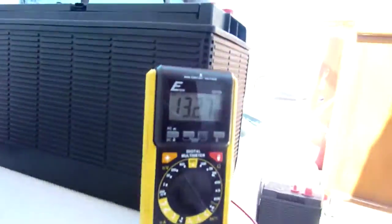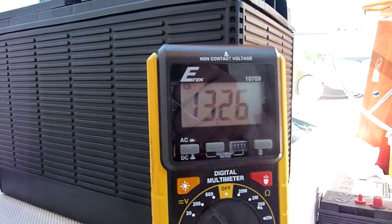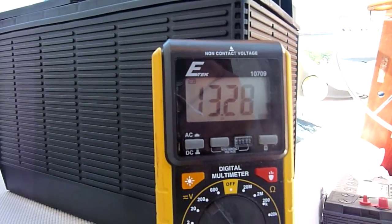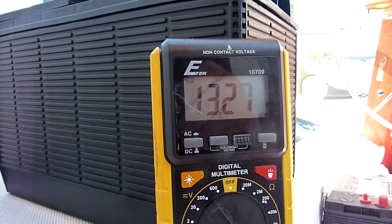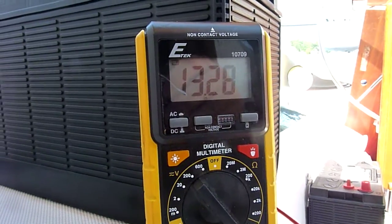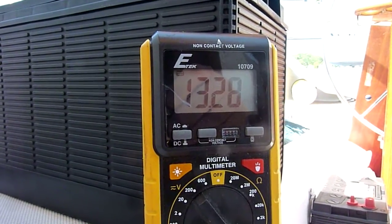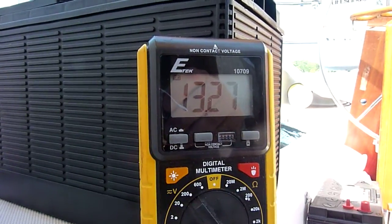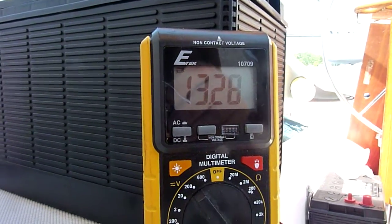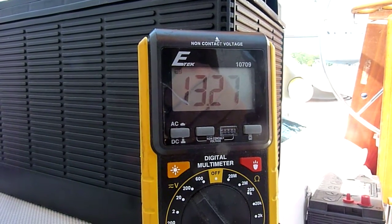Up here on this meter, we've got the voltage at the batteries, which is horrible. This is over a volt — roughly one volt of voltage drop between the back of the alternator and the batteries. This battery will never get to 14.4 volts because the alternator is already there, limiting itself in voltage. And these batteries are chronically undercharged. They didn't last very long; they won't last very long.